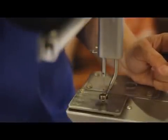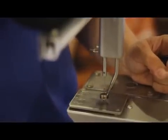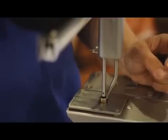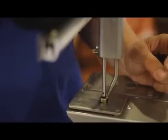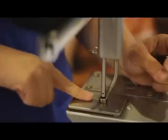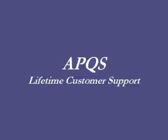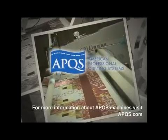Now when I do the function on the machine for our needle position, we can see that it's taking a full second to go from needle up to needle down. If you count in your head — 1001, your needle will go up; 1001, it should go down. That's the ideal positioning speed for the machines. We'll see you next time.